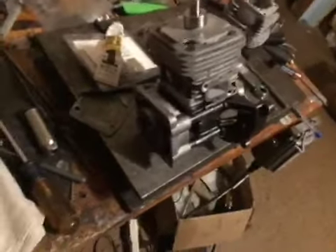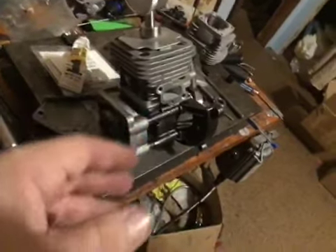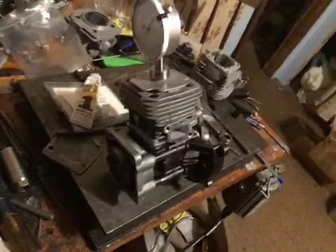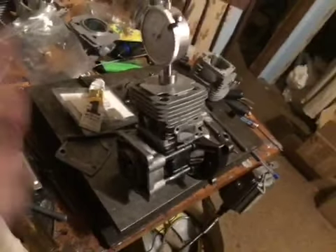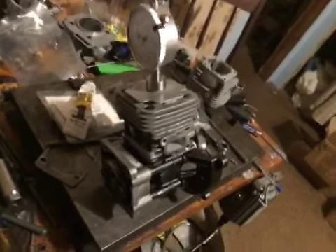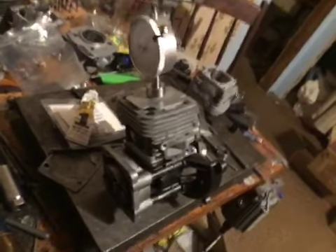It's coming along though — clutch is all lightened and on, crank is all trued and installed. It's got ceramic bearings in it. Like I said, the BART transfer plates, ported cylinder, machined and stuff. The squish is right where we want it — we know that freaking works.